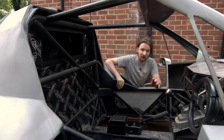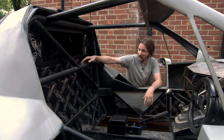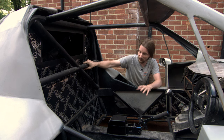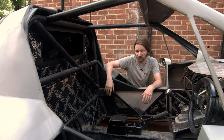As for why we're doing some of it now — we're still fabricating, and once you've got this stuff on you're not welding anywhere near it. You can't take it off to weld; it sticks pretty well, and being an adhesive rubber you definitely can't let the heat from welding get near it. So we've got to be quite careful with where we put it in, breaking it up in stages.